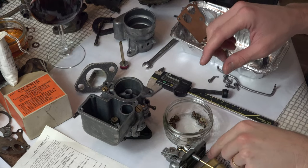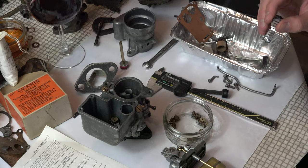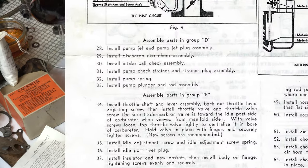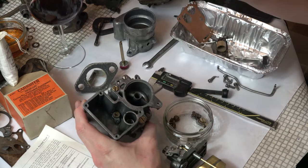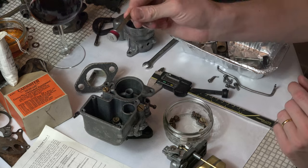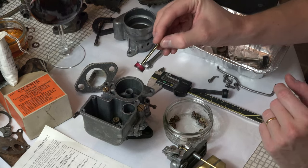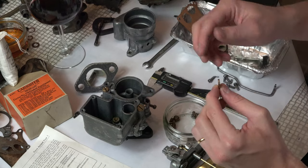Let's take a little step back. We've got install pump spring — we're going to work on the accelerator pump now. This is a pump spring, it goes down the cylinder there — drop him in. Now it says install pump plunger and rod assembly. This is important so you need to pay attention. One of the major problems with people's carbs is you get a flat spot once you push the accelerator, and then the carb picks up — what people say is the carb bogs down.